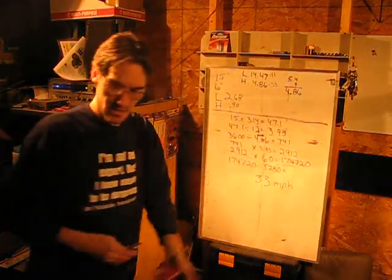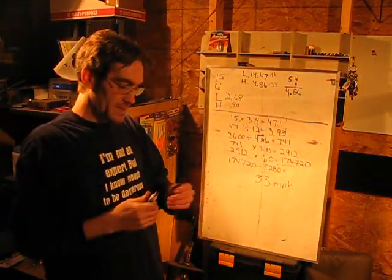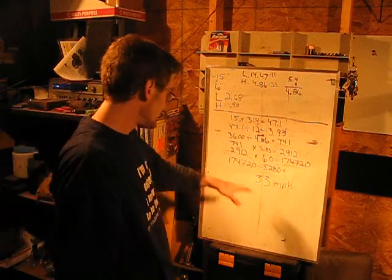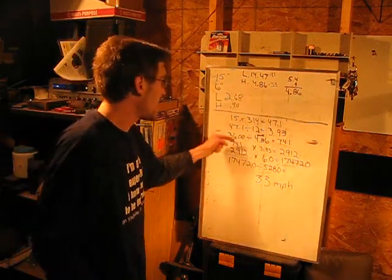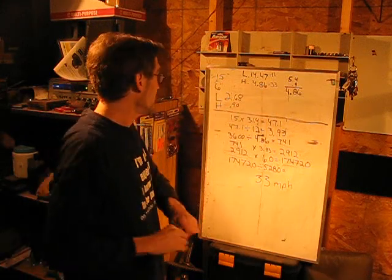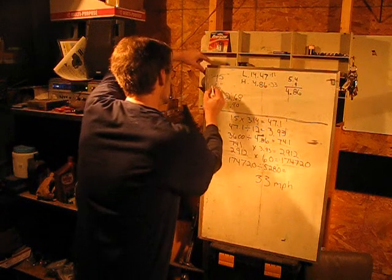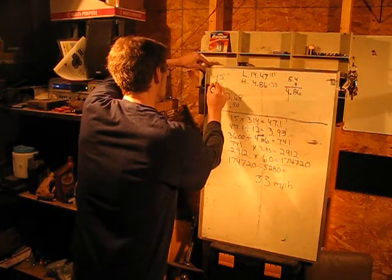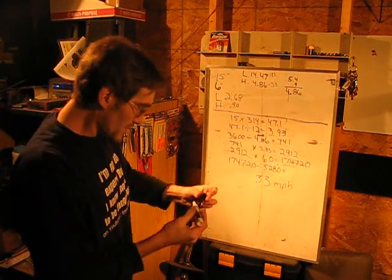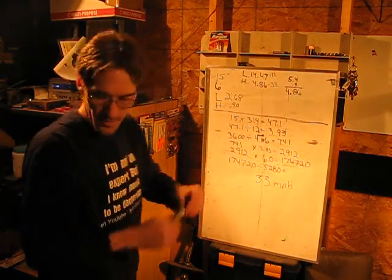So that's the calculation that you have to do when it comes to using a torque converter. You have to do both calculations for the high and low end. Now remember that we were sticking with only a 6-inch driven unit, not the 7-inch. With the 7-inch, these numbers will be smaller, but your cart will have more power.